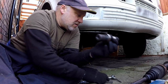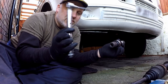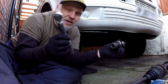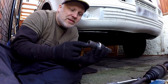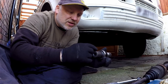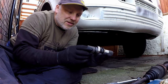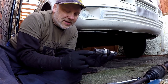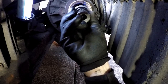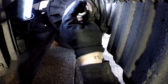We're going to put that in. Got a long 6mm and torque wrench — I've set that to 35Nm, it's probably 30 to 35. Also on the end of there you need something called EP2 grease, smeared on the outside. So let's get that popped back in. You're going to need a little bit of a lever bar against this because that's spring loaded. Just click and in.